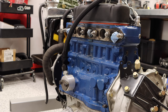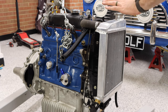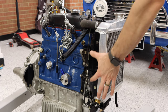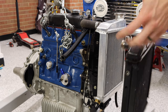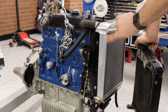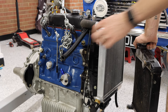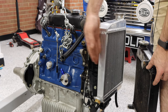The last thing I want to show you is something I am absolutely over the moon with — this new aluminum radiator. You might think you can always get an aluminum radiator, but on a mark one mini you have a built-in radiator shroud on the body of the car. If you're using the standard two-piece shroud mounting hardware from the early cars, you can only fit this thinner original radiator, which considerably reduces your cooling capacity — especially on an engine like mine that needs a lot of cooling. But I discovered something really cool: on the later cars they got rid of the built-in shroud, and the new radiator mounting bracket they used is skinnier and not as deep, giving you more room to fit a larger radiator because it's pulled closer to the engine.